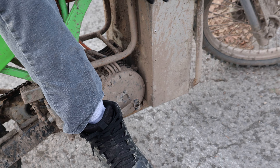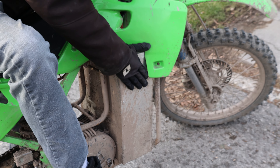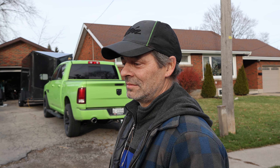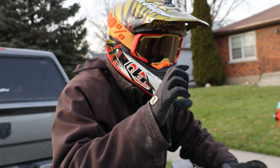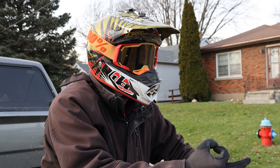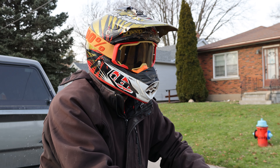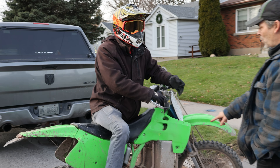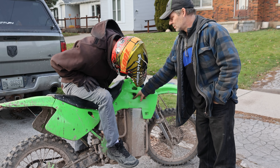What do you think? This is my buddy Bill's custom KX — technically it's the 3 kilowatt motor, QS, yep. But it's the Far Drive 850, pumping 850 phase amps, 450 battery amps. And what you've seen is 75% of its power right now — it's capable of more. This 72-volt battery — how many amp hours? 88 amp hours. And there are 800 Sony VTC4 cells in there — it's like a lithium-ion, about a D or C battery size. The battery will do between 1200 and 1800 amps continuously.